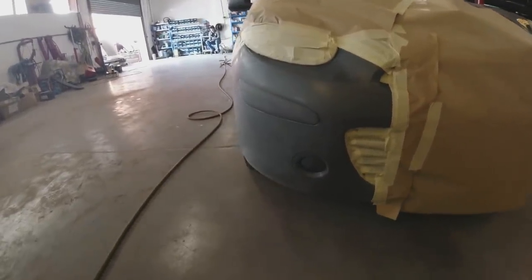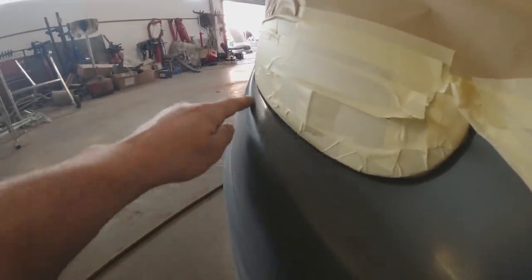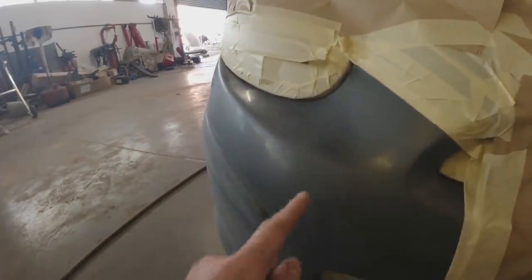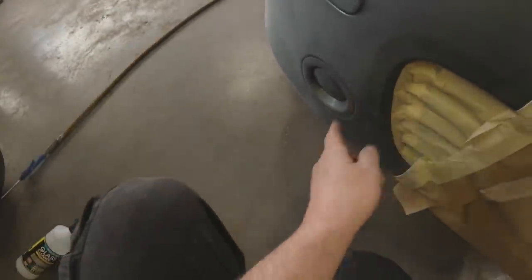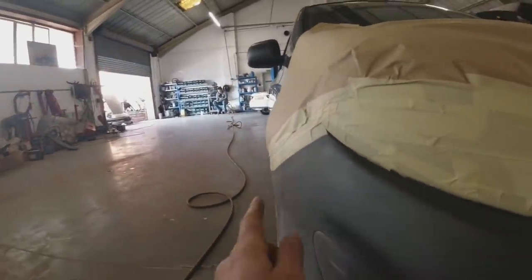So all masked up now - excuse my gimbal work, getting used to it. I don't have to go crazy because I'm only using rattle can, so it's not going to blow all over the place. I need to panel wipe this all down and put something over the wheel to stop paint getting on that. As I look over the car I'm looking for anywhere where I can still see a little bit of shine, because that is where the paint would lift later on. You don't want to see any shine in the area you're painting, because it's going to flake off straight after - it's got nothing to grab to. These areas here I just want to lacquer and blend, with colour sort of here and here, then lacquer there. I don't want to get colour up on the very edge of the panel where it meets the wing, as that would be obvious.